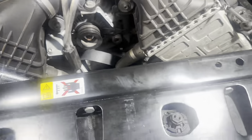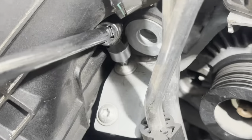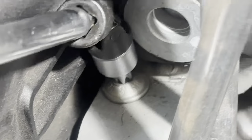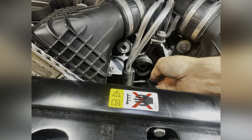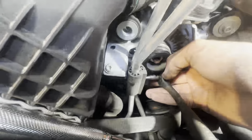To access the auxiliary water pump, first remove the tension — remove the belt to gain access. It's a T60 on a long extension as you can see right there — that's your tensioner. For that one use a swivel, remove this bolt to give you a little bit of leverage, push down on it and it'll come right out. After that bracket is separated from the top, you're going to remove three bolts — three little Torx T10s — that are holding the bracket to the pump to get the pump out.